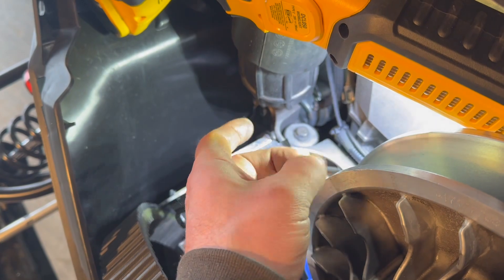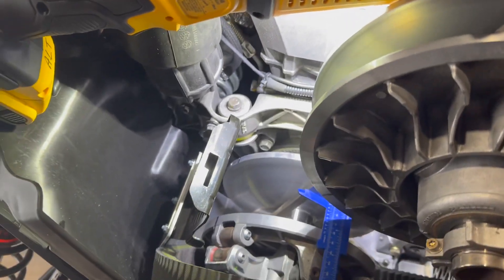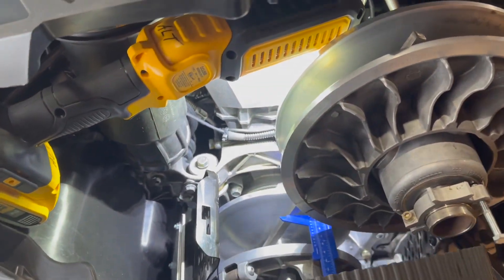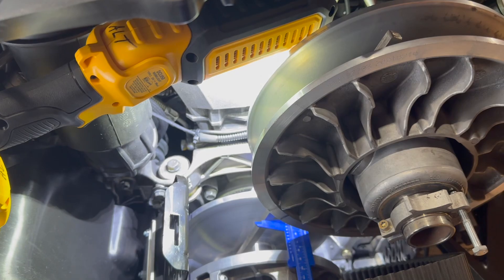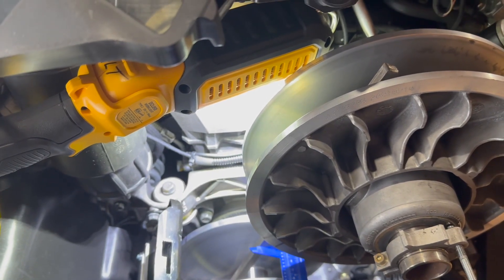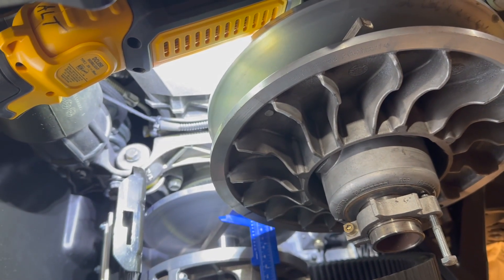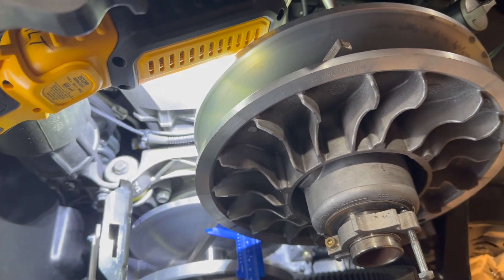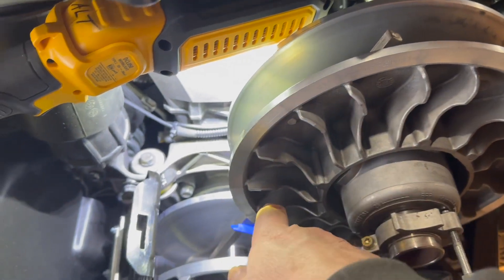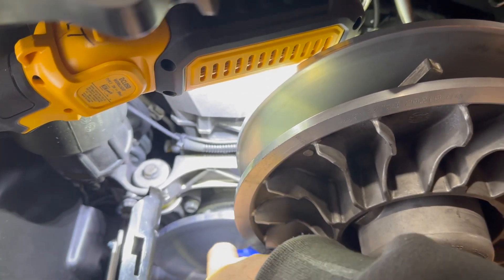As the belt pulls the clutches toward each other, it torques the motor up — the clutches go toward each other — and you're supposed to pull the primary into alignment. That's why you really want that plus 1.5 to 1.63 millimeters, because once you're under load, you want to pull that engine into alignment so it's perfect. I don't know why the specs show anywhere from zero to 1.63 — hopefully yours is more on the 1.5.